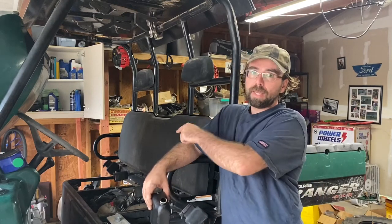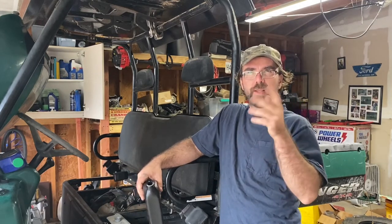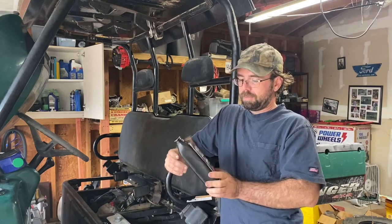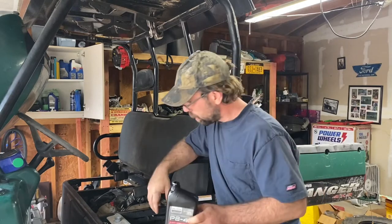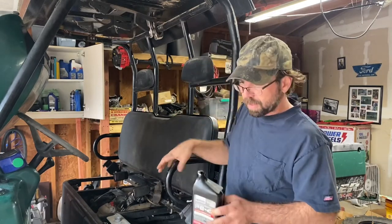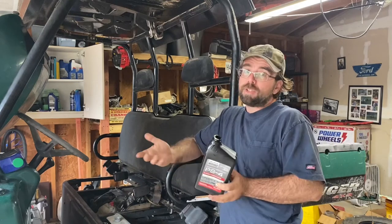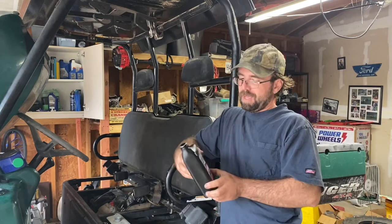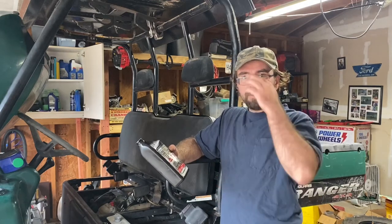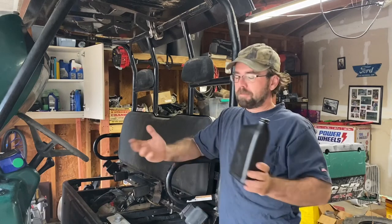Add eight more ounces and we're full. A lot of people don't realize you have to drain the engine as well - most people just drain the reservoir. When you drain just the reservoir and filter, that's your two quarts. Draining the engine gets you an additional 24 ounces out. So essentially you need three bottles: two full quarts and 24 ounces of the third. Total is two quarts and 24 ounces to do an oil change on a 500. Within about an hour we've got all fluids changed - front diff, transmission, rear diff, and engine.